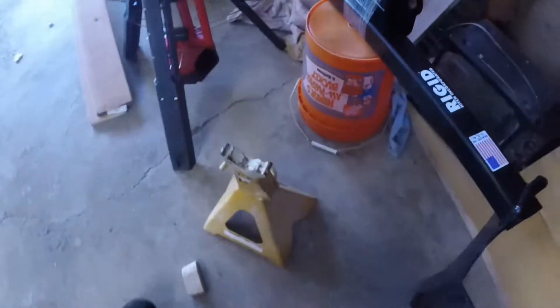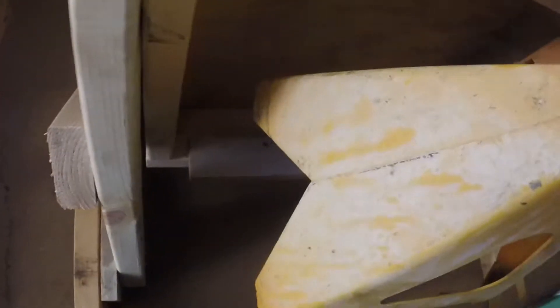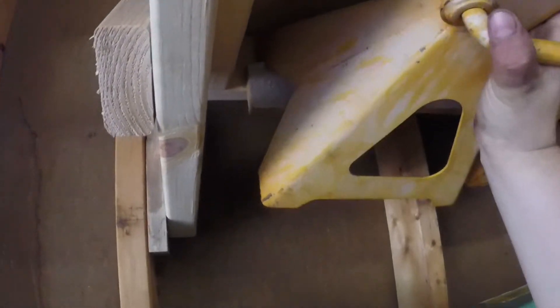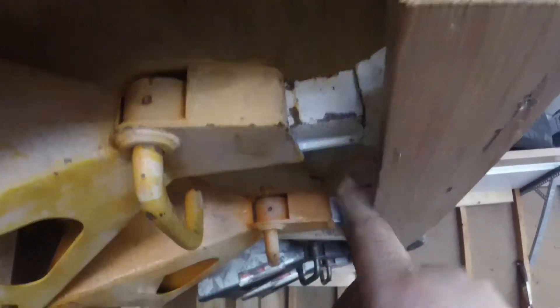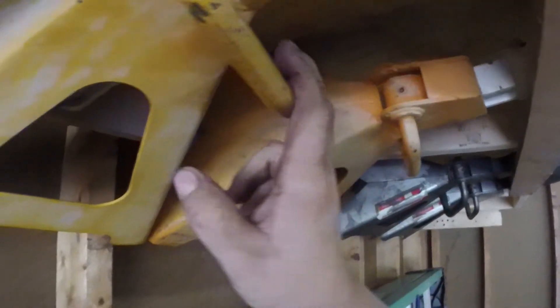There's no gap — they lock in right above there. What you do is take the jack stand, put the jack part up first, slide the ears in, then pull out the jack stand so it rests against this, and push the handle back so it locks in. It can't just fall off.